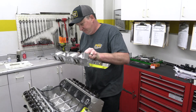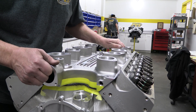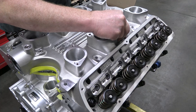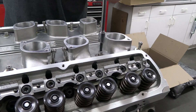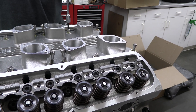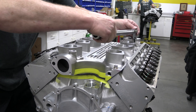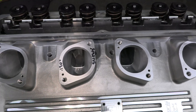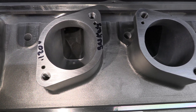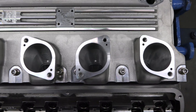A plate bolts to the underside of the intake, and an O-ring sandwiches between the plate and the casting to seal the chamber from the atmosphere. The plenum casting then goes on over the lifter valley just like any other intake manifold. Some of the bolts slot right up against the outside of the intake runners, so to make installation and removal easier, Prestige uses socket-headed bolts. Each combustion chamber gets its own dedicated intake port, and each port has a hole drilled into it that leads to the balance chamber — the small hole at the 6 o'clock position on these ports.